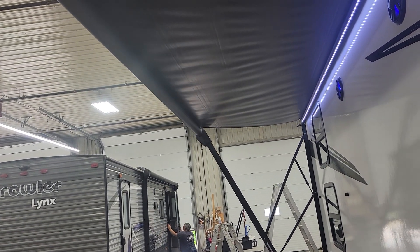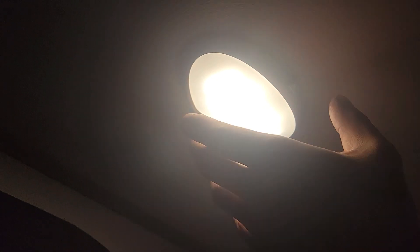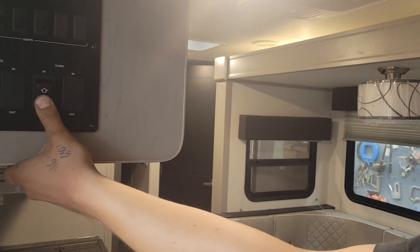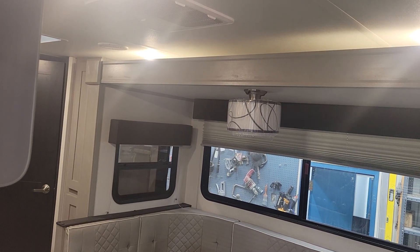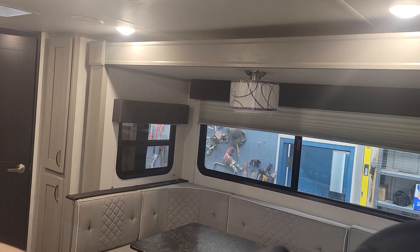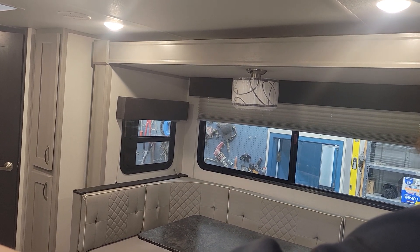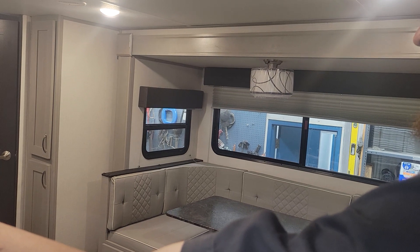While waiting on the awning, here's a look at the motion sensing light. The switch on the back side: one on the left is just on, and two is going to be your dual function using the motion sensor. The slide out is on the right side here — press and hold out and the slide will make its way out. Once it's fully extended, you'll hear the motors kind of whine and then turn themselves off — that's normal; that whine is just them squaring themselves up.